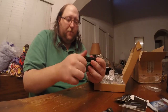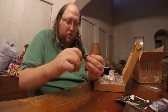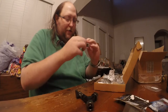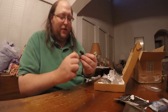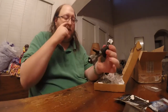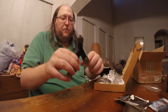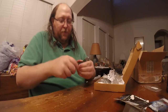We need one of these to come onto here, and this will come onto here. This is something you can do with a custom loop but not with a pre-made one. Then we'd have another one of these which I'll unwrap now. This would go off to a tube that would have nothing on the end — the drainage point. So this whole thing is going to be sitting inside the case. Off the pump outlet, this goes out for the rest of the loop, and this comes down for the bleeding system.